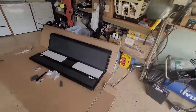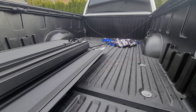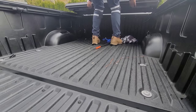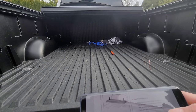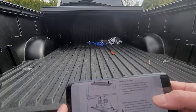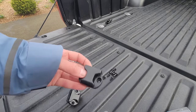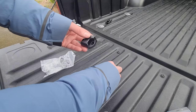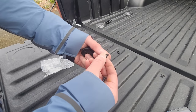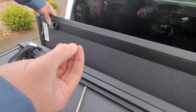Moving on to the tonneau now. The tonneau itself has a pretty good weight - maybe 50 pounds or so. Place the tonneau cover and fold it into position. Remove the shipping foam, then raise the front panel to install the two buckles in the pre-drilled holes. You need a buckle, two plastic sleeves, and two screws - the plastic sleeves go in through the back, and then the screw goes in from top down.